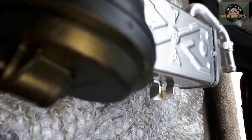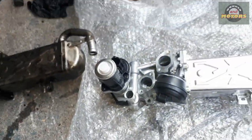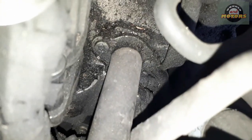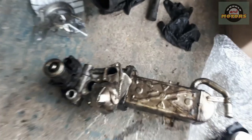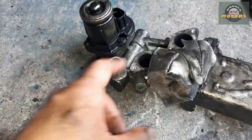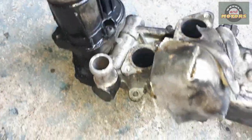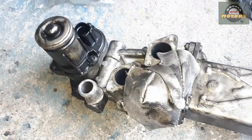Make sure it's the same electrical connections — everything's happy. This is where we're going to put the vacuum hose on. We'll just swap over this heat protection. I'm going to take this pipe out — clamp here and two screws — to clean it up, change gaskets, and off we go. The actual EGR wasn't that dirty. What I like about this new VW design is that it's so far away from the intake so it doesn't get any oil — it's only soot — so the pipes and valve don't get clogged up. It's just a mechanical or electrical failure, which you'd probably expect at 320,000 miles.